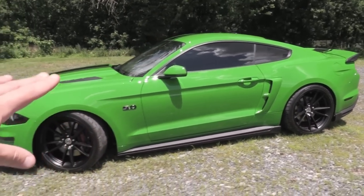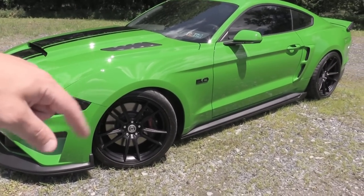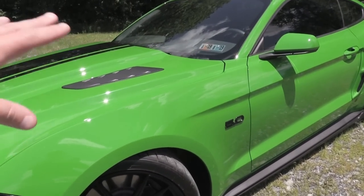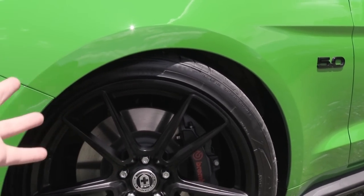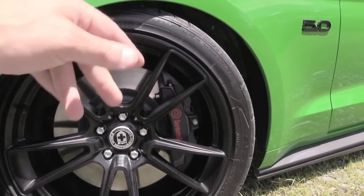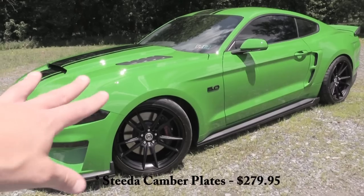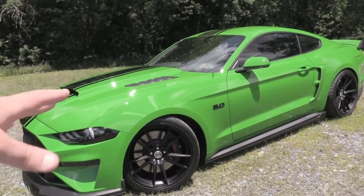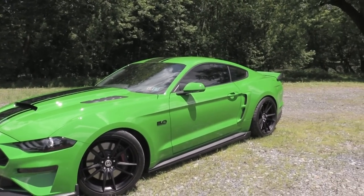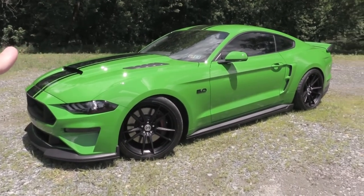One more thing I want to mention — I actually made a video about messing up modifying my Mustang GT. If you go with the Eibach Sportline lowering springs, I would definitely recommend also getting a camber adjustment kit. With the more aggressive 1.5-inch drop up front, the wheels tilted in slightly. To fix that you need camber plates. I went with the Steeda camber plates, which work fine now. They did give me a loud grinding noise initially, but I talked to Steeda and they said it's normal until they break in — and sure enough, it went away after about two months.